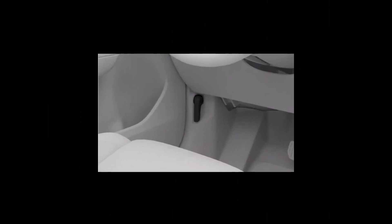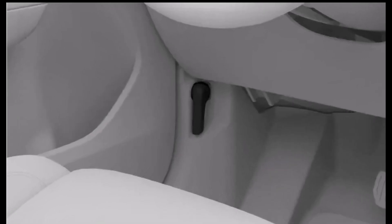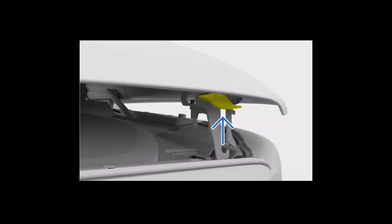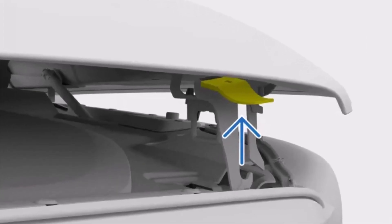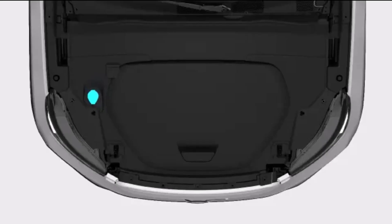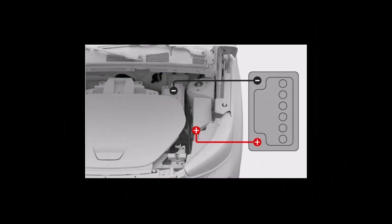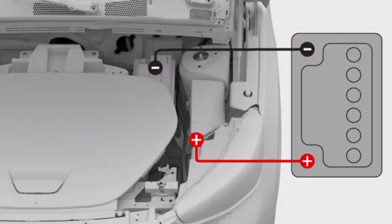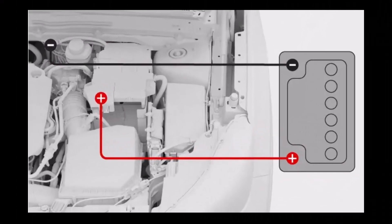Back to the Polestar 2 and the Volvo XC40 and the EC and EX40 — you should be inside. Open the hood by pulling the lever below the dashboard on the driver's side to release it, then lift the handle under the front edge of the hood upward to open it fully. If you're using the battery in another vehicle, turn off the vehicle's motor initially. Remove any panels under the hood on the driver's side and at the back to access the jump points. Clamp one end of the positive jumper cable onto the assisting battery's positive terminal, often marked in red or with a plus sign. Then uncover the positive charging point on the vehicle being jumped. The EC and XC40 and Polestar 2 points are in a similar location, while the EX40 is further back and to the center.